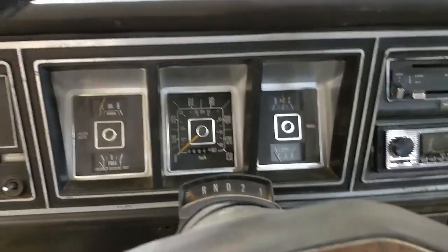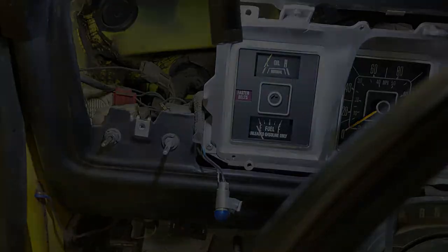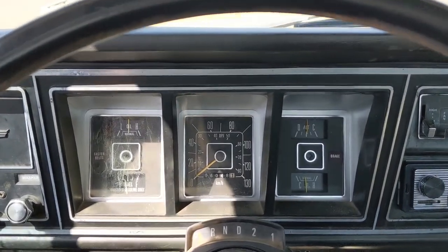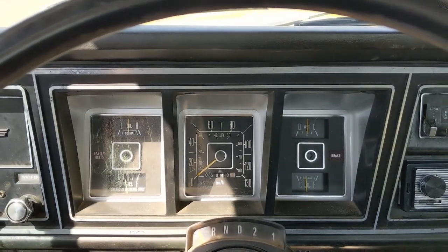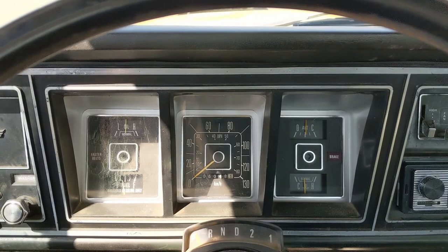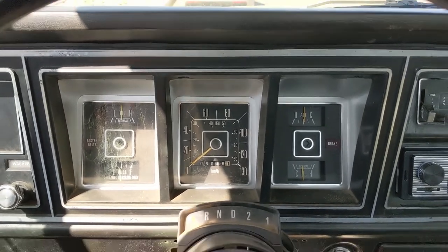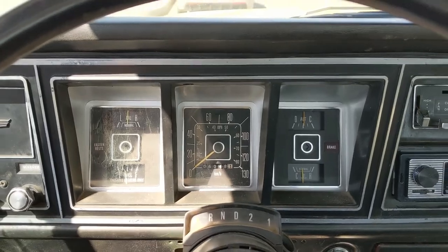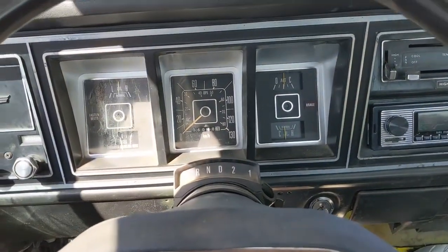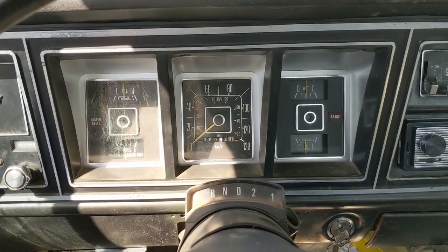It'll be road testing to see how we did. I had her out for a test run — she's pretty much bang on. It's out maybe a kilometer per hour, which is hard to tell because the GPS jumps around two to three kilometers per hour. I'm going to be good with that. So it's the orange drive gear, yellow driven gear, and the speedometer needle is fixed.